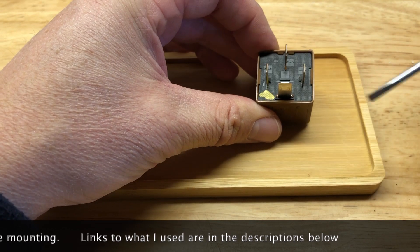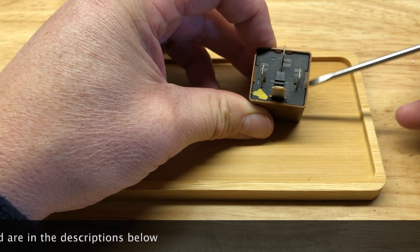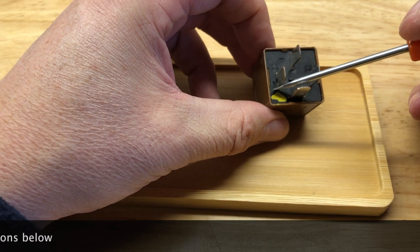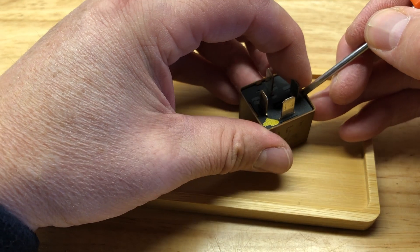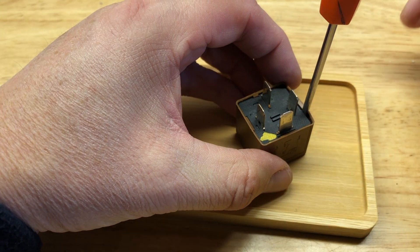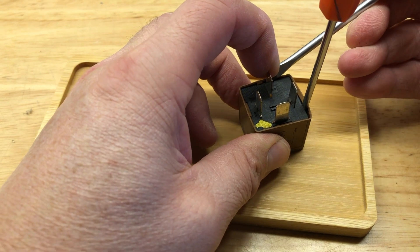This is slightly different depending on the make of your relay, but most of them are exactly the same. The plastic cap we need to take off — on the Jaguar one it's held on by these little sprung tongs, just clipped on, one on each side. The trick is to release at least two diagonally opposite ones at the same time. If you've got a friend to help you it's so much easier, but otherwise pop a little screwdriver in the gap. Don't do it on too cold a day or you'll just snap the plastic.